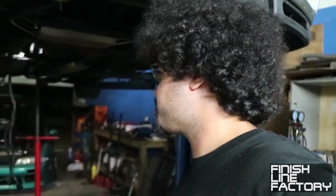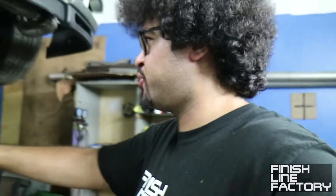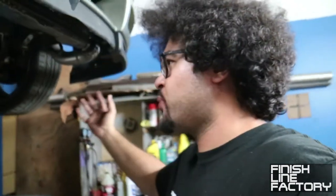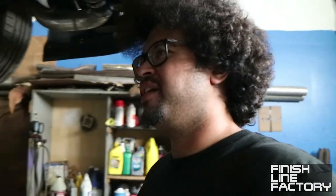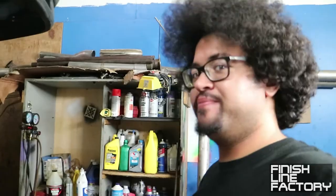I'm on the way home from my friend's house, and we were doing all the work. And next thing you know, boom! I was shifting from third to fourth. I wasn't driving hard at the time. And that was it. Just boom, boom, boom. And I thought maybe we dropped the drive shaft or something. So I pulled over. I'm like, no, it's definitely internal to the transmission. You put the clutch in, it stops making noise. And it's so bad that when you put it into first gear, or you try to move around, a chunk of gear will move into the mesh and prevent you from moving. Yeah, it's pretty bad.